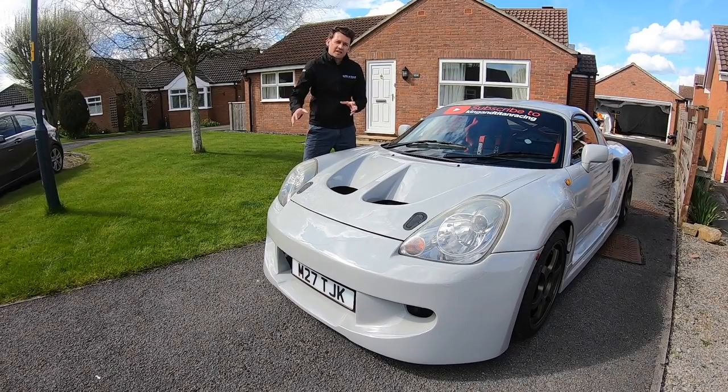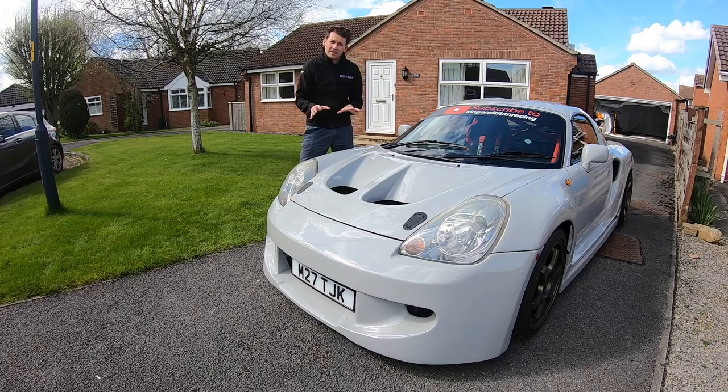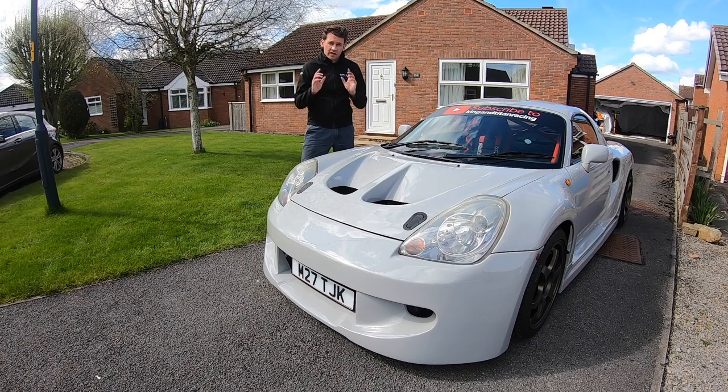I've now gone over and touched up all those edges and those last remaining bubbles, so that's now ready to settle. I also took some time out to do the sun visor, which if you're going to do this job, I'd heavily recommend as a starter, because it gets you used to working with vinyl, and that's a very similar technique. This is technically one of the most challenging jobs I've ever done, and actually I think it is the hardest job I've done on a car, so I definitely recommend getting some practice before you start this one.